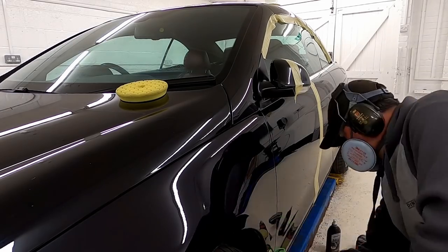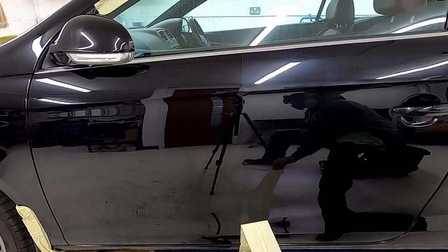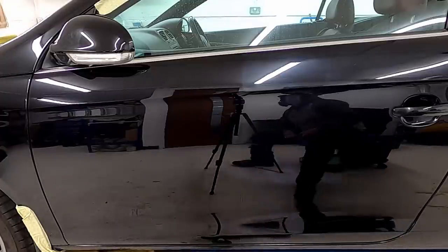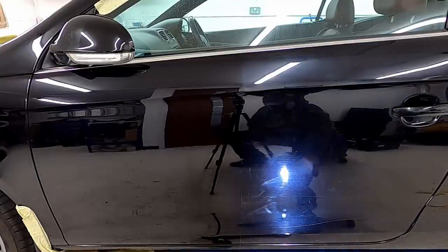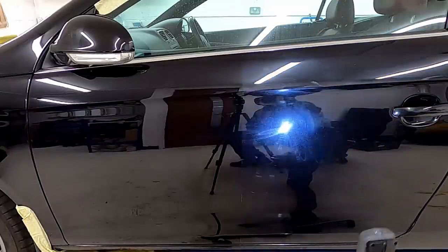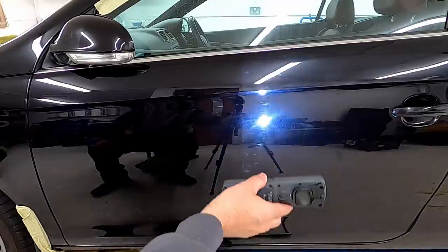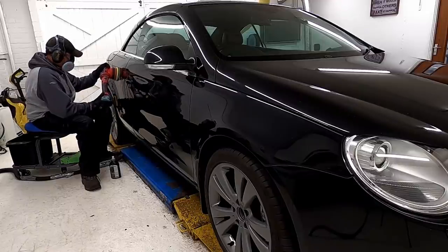With that done we can do a much larger 50/50 on this door. I pull the tape off and then use a cloth just to rub the residue off where the tape's been, and then get the inspection light and have a look at it. As we can see on the right there's quite a lot of marring, scratches and also evidence of buffer trails where it's been previously machine polished badly - the top edge just looks unsightly. As we flick over to the left-hand side, again it's far from perfect and this would probably be a starting point for some detailers, but it's a big improvement - it looks a lot darker as we've repaired and put the gloss back in the paint.